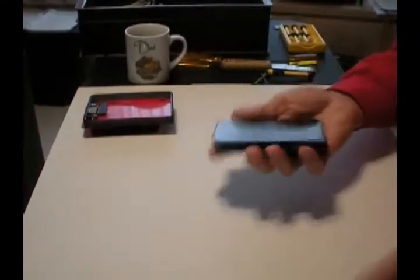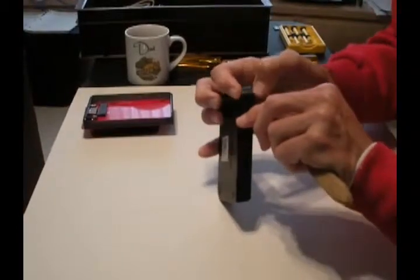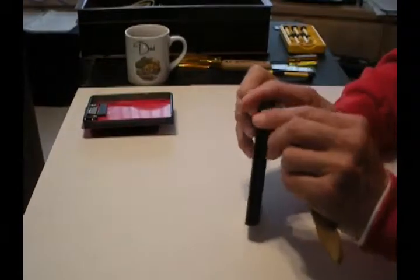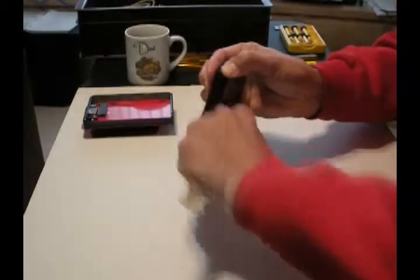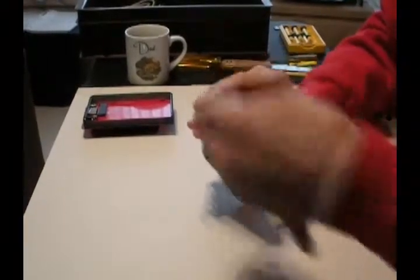What we're going to do is open this case up here. About the only way to do it is to get in there and pry at it - there it goes, it's popping out a little bit. This is not that complicated a case. We got a little flat blade in there and we're just going to work it until we get that thing out of there. It's popping out - not so bad. We can see our disk drive and the circuit board in there. There's our USB connector under the rubber thing, and there's an LED.